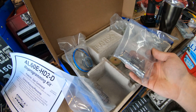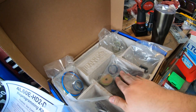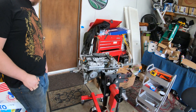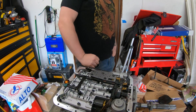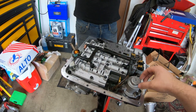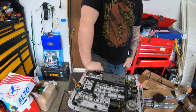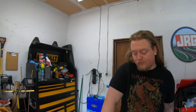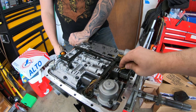Overall it doesn't look like a lot of parts — we got these new springs and pistons, as well as this guy. We might need to take out the pump again, which kind of sucks because I didn't know we'd have to do that, but also not the end of the world. We're going to go ahead and start taking off the electronics, just unbolt the valve body and separate it. There are check balls in there that need to be managed, but since we have this awesome stand it's all level and we won't potentially lose anything.